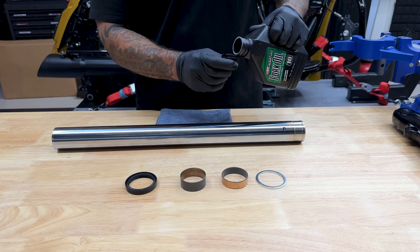I'll slowly lower the bike onto the tire until I get the holes to line up. With this new flush axle, I'll add some anti-seize. I'll also add some anti-seize inside the right axle hole and inside the spacer, and also to the inside of the wheel speed sensor. I'll get this flush axle in — don't forget your spacer and your wheel speed sensor and which way they were orientated. My spacer with the groove lines was facing towards the rotor. On the wheel speed sensor, the spacer was outboard and that rubber was inboard. You want it to touch and then just back it off a little bit.